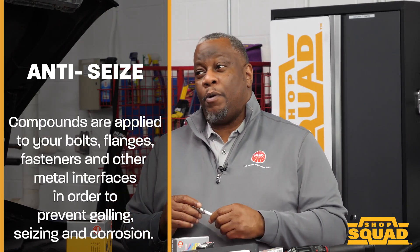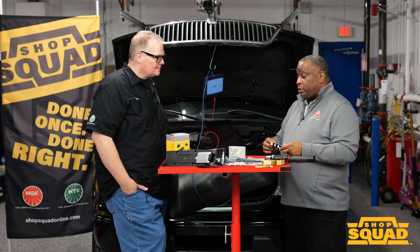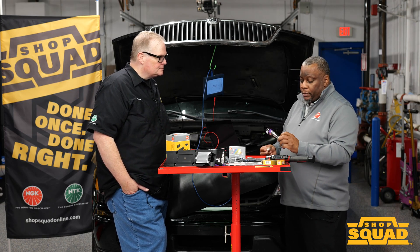That's relevant if you don't add anti-seize. We want to make sure we're crystal clear: on spark plugs, you don't want to put anti-seize. The plug already has a trivalent coating on it, so if you add anti-seize it could actually cause you to over-torque the spark plugs. No anti-seize, don't over-torque — that's the only aspect you need to be concerned about. The trivalent coating creates a nice surface that will not corrode, so the technician doesn't have to worry about seizing the spark plug later on.